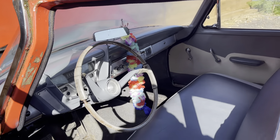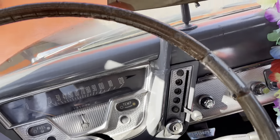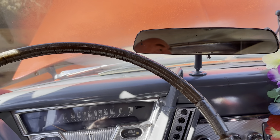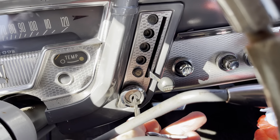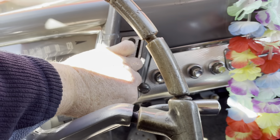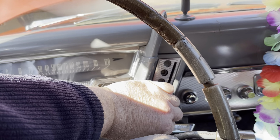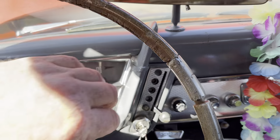See if I've got the keys in my pocket — I'll fire it up. I'll back the choke off on it a little bit. I put a new carburetor on it and the choke would stay on too long, so I'll back it off a little bit. When you start it, you might have to feather it to keep it going — a couple of pumps and she's away.